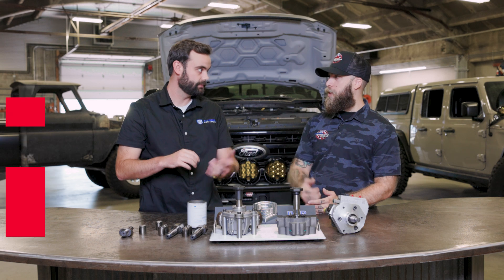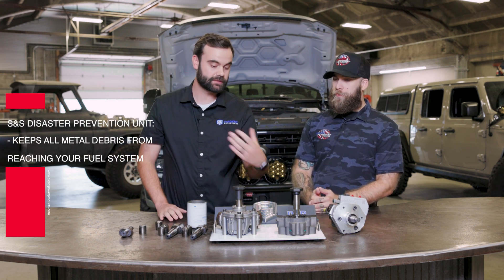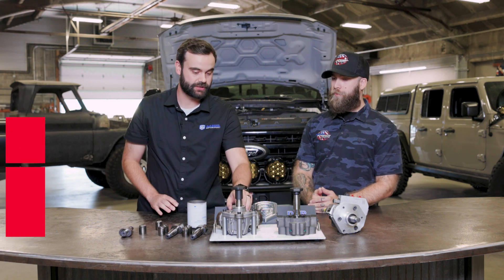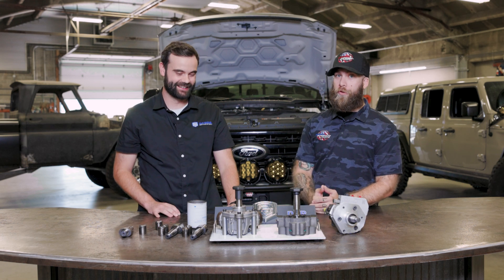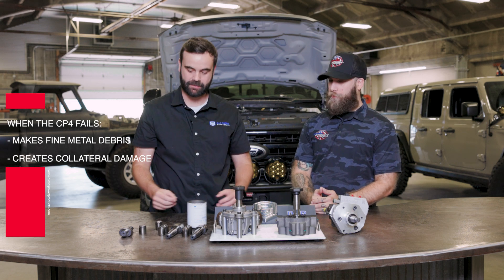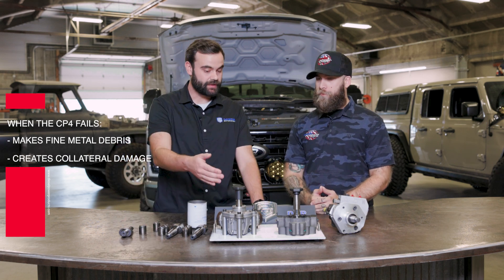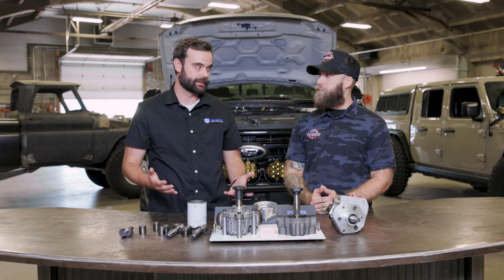That's where the DPK helps solve that issue. Our DPK won't prevent the pump from failing, but it basically blocks everything in the case and keeps it there so it's not reaching your high pressure side. That way you don't have to buy a new set of injectors once your CP4 grenades. When the CP4 fails it makes fine metal debris because it's metal-on-metal contact with that roller on that cam. When it fails, it's not just wrecking the bottom end of the pump — it's creating tons of collateral damage.